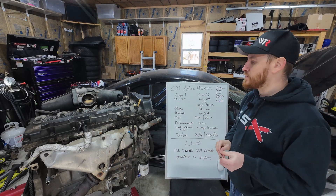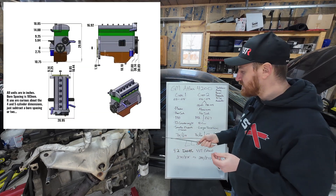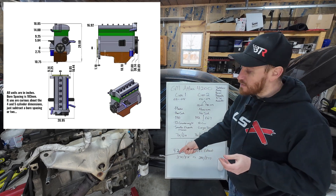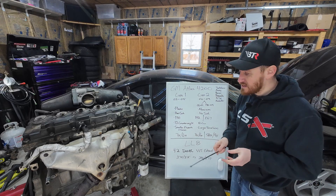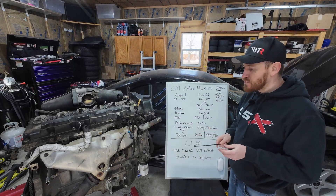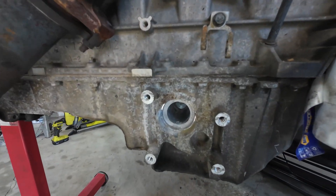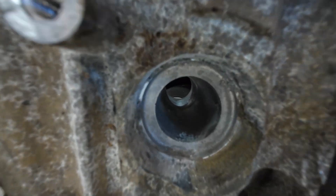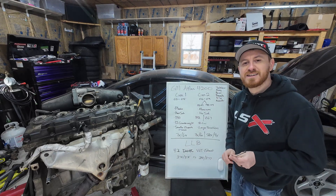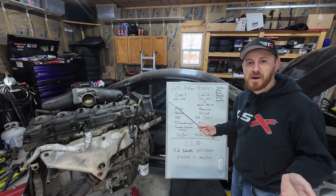When you have these newer generation cars you're losing a lot of that hood clearance. This motor, if I'm not mistaken, is about 32 inches or so front to back, and from the bottom of the block deck to the top is about 22 inches, not including the oil pan. The 4200, unlike the four- and five-cylinder, only came with a front-sump oil pan. In the all-wheel-drive application, a half shaft rolls through the front of that oil pan.